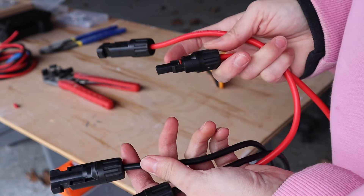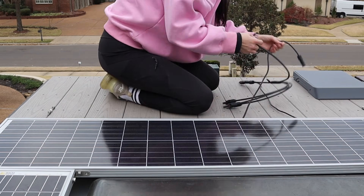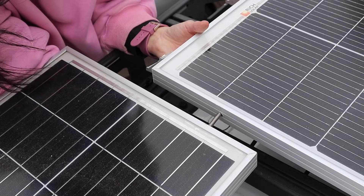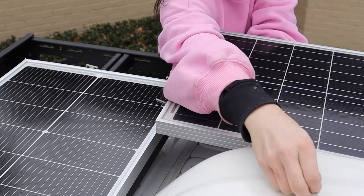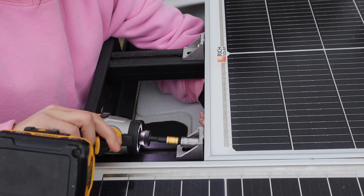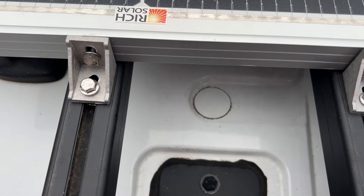Once my extension cables were made I chose to add them to the parallel passenger-side solar panel, because all of my other solar wiring sits on the driver side of my van. Once all of my positive and negative wires were connected to the four-way connector, I started mounting everything. I started with the panel-to-panel mounting points, running an M6 bolt and washer through one panel, adding a washer, sliding it through the second panel, and securing it with a third washer, lock washer, and a nut. Then I got my brackets snug on the solar panels before mounting the setup onto the roof rack using M6 16-millimeter locking hex bolts into pre-installed T-slot nuts.